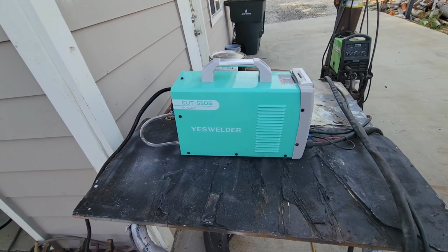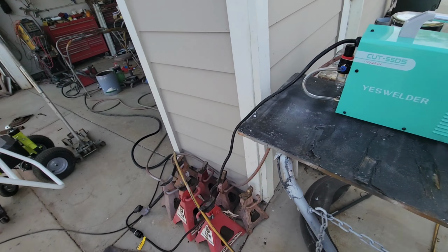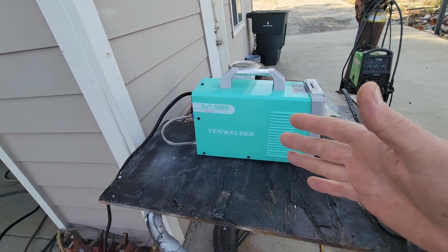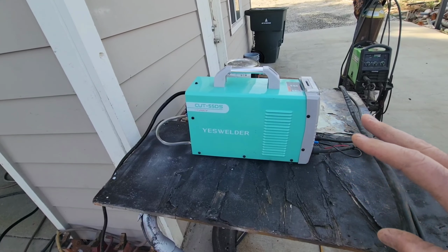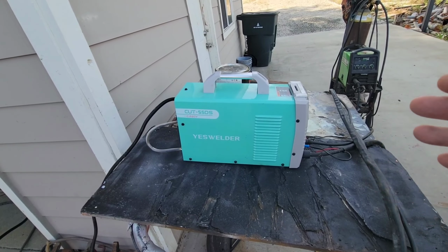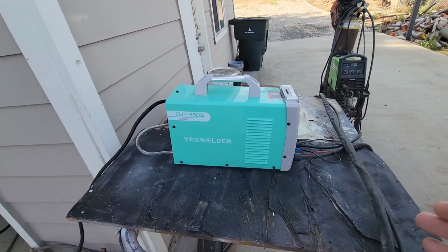I have used it a bit. I do use it on 220. Almost all these plasma cutters, most of the other ones, only work on 220. This one, I tried it on 110. It seemed to work pretty good on 110, but I'm not going to say it's a 110. I would always recommend using these on 220. But